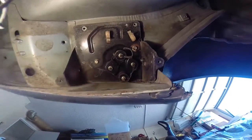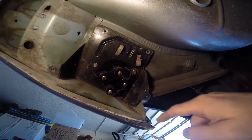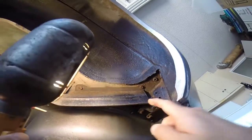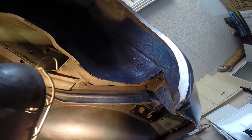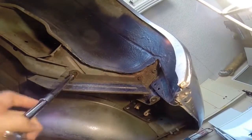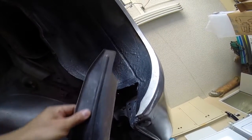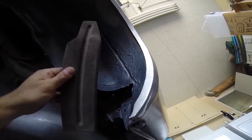Fuel pump out — a little spider-webby. I'll clean it up, gonna leave it in the vehicle, it's fine. It's looking nice. Everything down here is still shiny. This plate here got painted from the other side — looks like overspray from the wheel well undercoat. These bolts are rusty, they gotta go. Probably should have lubed them from the other side, but they came out. Definitely should have put PB Blaster on them, but I got lucky, so we're good. That's the shield that protects the fuel line that goes from the trunk floor back to the fuel pump, which is mounted underneath the left rear fender well.